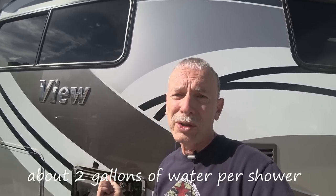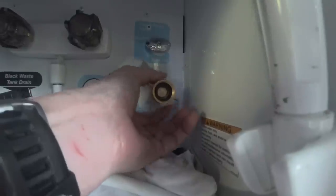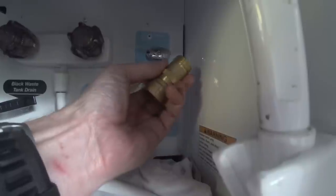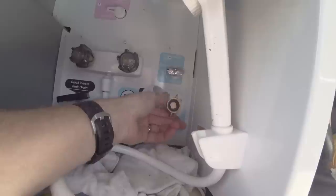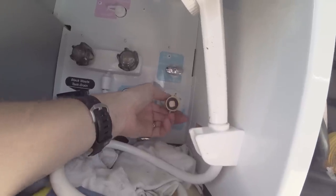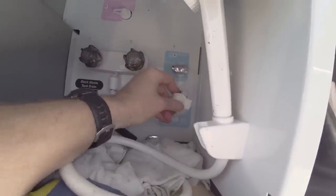Now I can pretty much just use the hot water only. It does get a little warm on occasion, but works pretty well. Even at 120°F our six-gallon tank will easily give us two showers with no problems. If you're in an RV campground and have access to city water, this is where you connect it. This is a little pressure regulator — it's very important to have this because sometimes the pressure can be so high it'll blow the plastic pipes. I just leave it permanently connected here, but we rarely use it. Mostly I use the gravity feed.